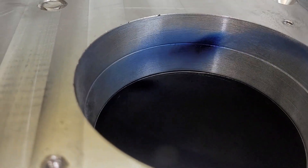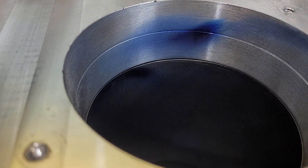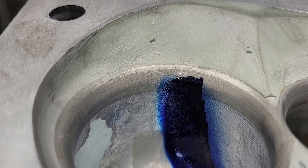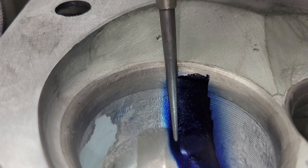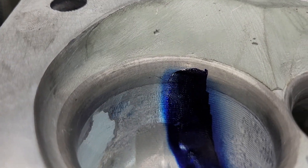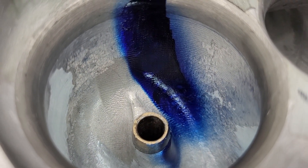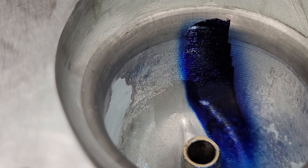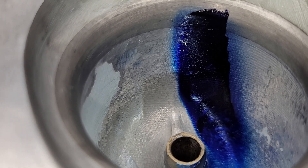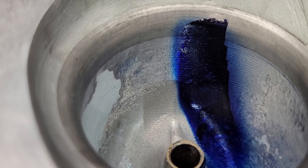Let's take a look at our angle — our angle is actually heading that way. Let's take a look at that port orientation. This has just the slightest angle off to the left. Our liquid flow is good; it goes all the way to the roof, which is great, but it's very thin. I'm willing to bet there would be horsepower in widening that out. I'll talk to the owner about what I think can be done.